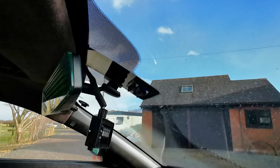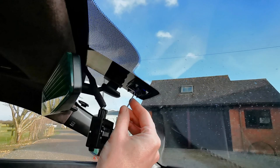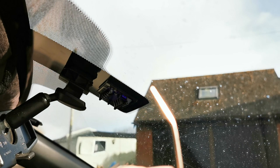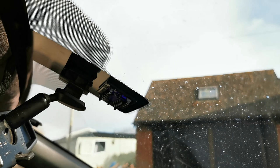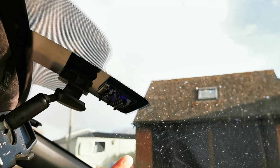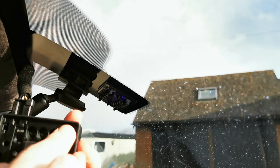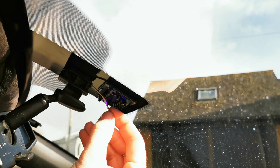What you can't really see in this shot — but I will show you in a moment — there's a tiny little notch just here in the rearview mirror mount. The tool I'm going to be using is a modified Allen key; as you can see it's got a slight curve to it. Series 1 owners don't need to do this. The only reason I'm doing it is because of this little pad here which is stuck to the windscreen — these little things work for the rain sensor. Series 1 RX8, at least in the UK, don't have auto wipers and auto headlights, so you don't have this problem. You can just use a straight Allen key.